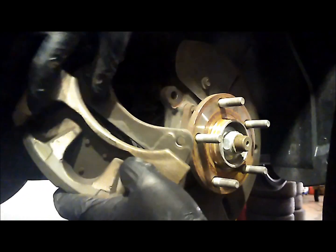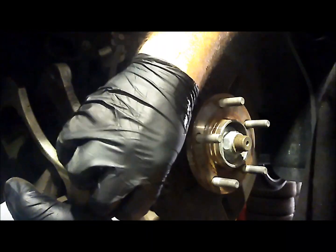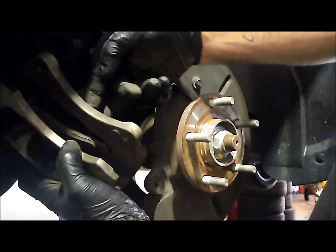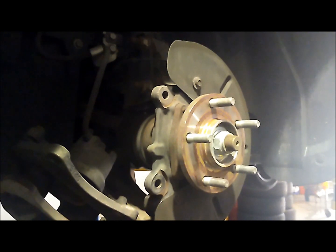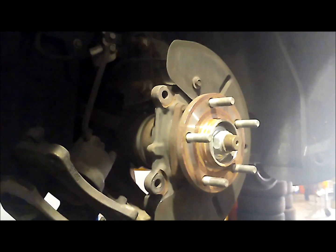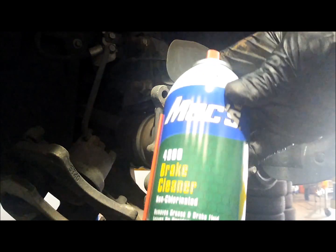Sometimes there are screws in between the lugs that hold the rotor to the hub, and they're a pain to get off — that's a whole other day. To push your brake pads out of your calipers, in my case you just push them out. Sometimes you have pins that go through the pads — that's typical on German vehicles and Toyota uses that system, so note that. A lot of people don't like hanging the calipers by the brake line, but I've never had a problem letting it hang when you've got a thick rubber brake line like this.